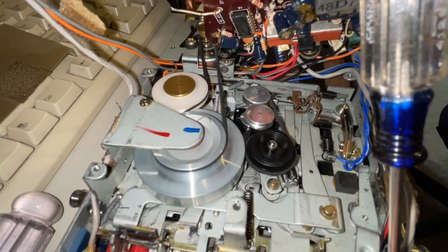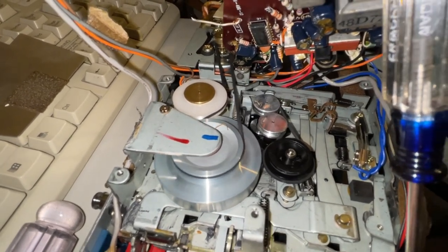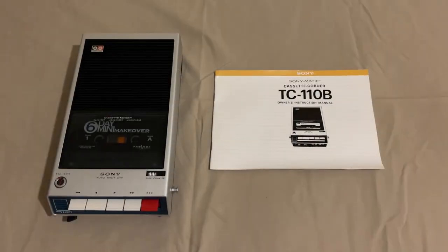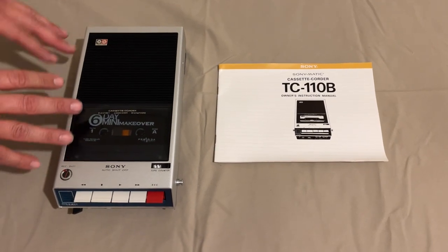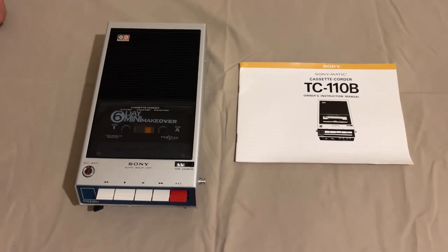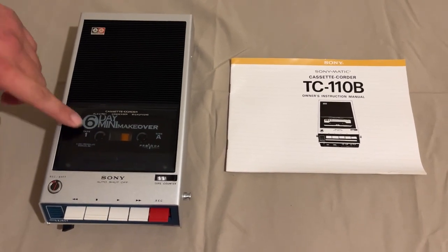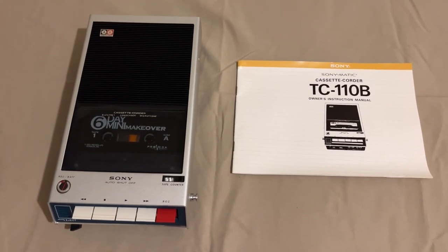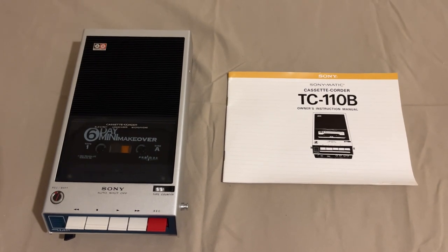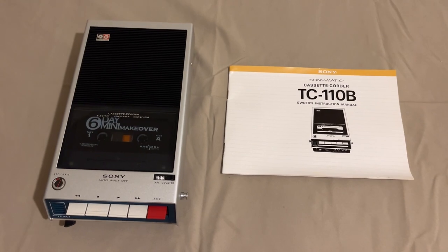So let's go ahead and put it all back together and wrap this up. Now we've seen what's wrong: the belt, after 43-some odd years, has lost its elasticity - which is to be expected - causing the reels to get stuck or start slipping on the belt. It still works pretty good though. I might fix this in the future, but for now this thing works well. Till next time, thank you for watching FDR Tech channel - check us out again.